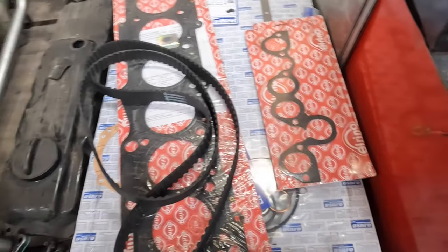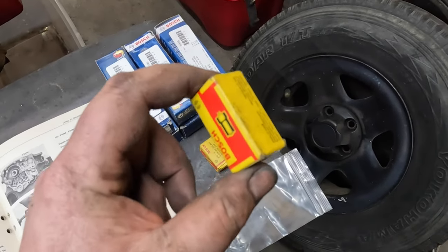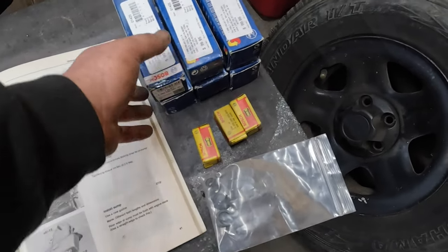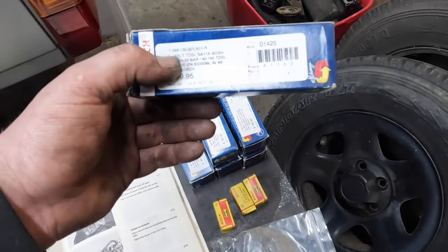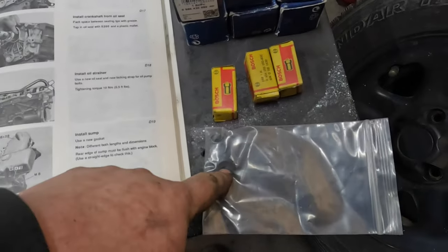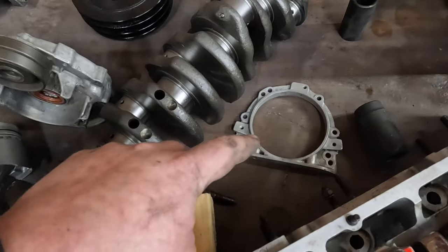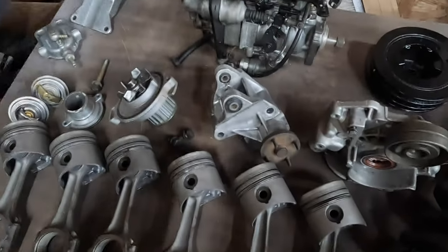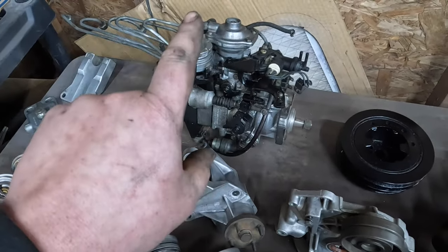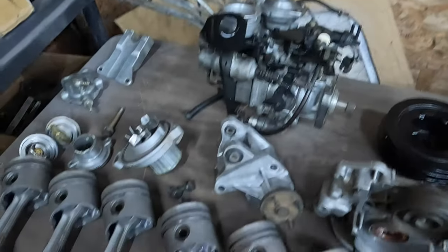The exhaust manifold gaskets are exactly the same. Also exactly the same are the injectors. While I did find three brand new injector nozzles in the glove box, I ended up finding complete rebuilt injectors before I could find three more nozzles. These came from Parts Place Incorporated from Michigan. If you're in the States, these are for a 1.6 turbo diesel — shared parts. As are the heat shields. Thermostat is a pretty off-the-shelf standard part, easy enough to get, as is the front and rear main seals. The big headache is the injection pump — if you don't have a good one, you're going to have to shop around for shops to rebuild those. The benefactor had already gotten that rebuilt at quite the cost before I even got the car.